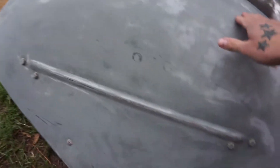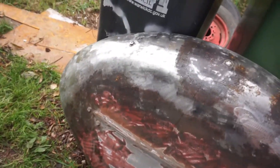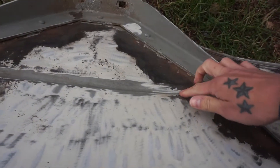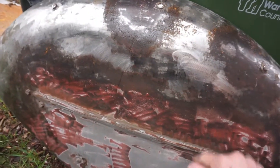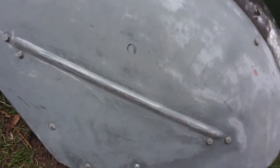It's a few days later — that's how far I got with that one. That wing and the other one have been sat here for a few days. I've taken all that paint off; there's a bit more I'll probably take off this. All this stuff wants to come off but I've had to use the angle grinder and the flap disc — sandpaper and even paint stripper weren't working on that. That face there is pretty much ready to be cleaned, sanded, and painted.